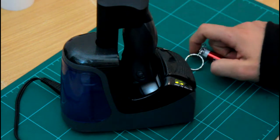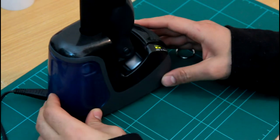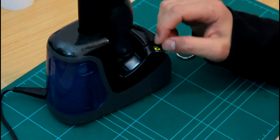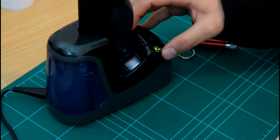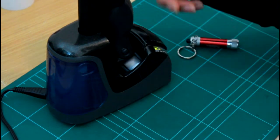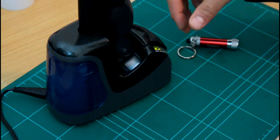Okay. So I think the two issues which fixed it were, one was the pump and the sealing of the pump, and also that all these outlets, those two holes, need to be thoroughly cleaned. Yep, just gonna do this a few times. I'm pumping the water in and turning it on. It goes through the program on and off to clean it.